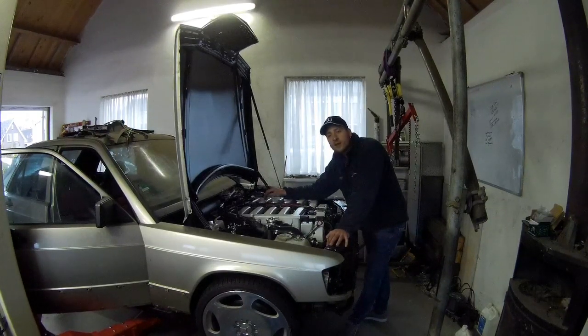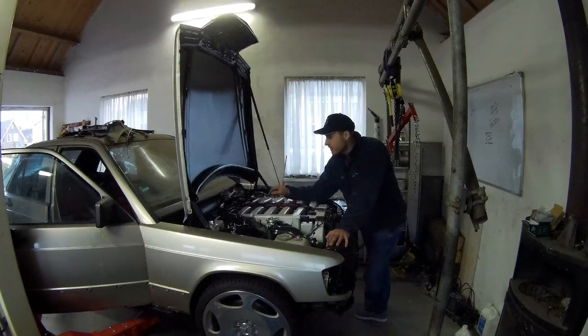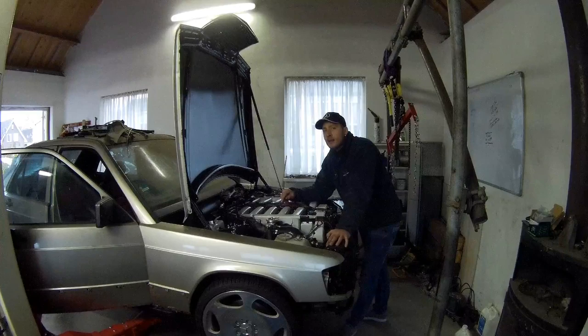Yesterday evening, I got the spark plugs out of it. They were pretty black, and that was also telling me that the lambda reading is okay. On this side it was very leaned out, but these spark plugs were a little bit wet from fuel. If you've got a misfire, it will lean out on your measurement. That also confirms that the lambda reading was okay, because there was too much oxygen left as you had a misfire.